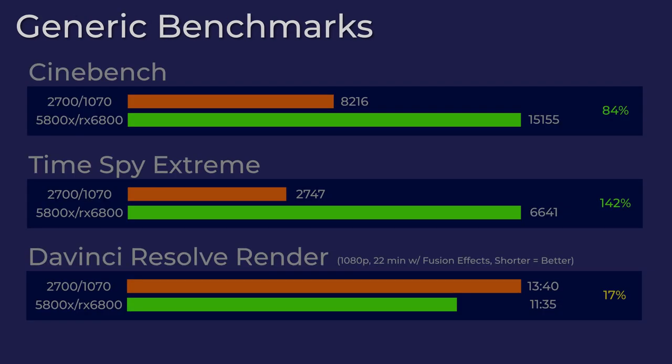So looking at some generic non-gaming benchmarks, Cinebench was just under twice as fast, so an 84% performance improvement. TimeSpy Extreme was almost 2.5 times as fast with a 142% improvement. For the DaVinci Resolve render, I took a 22-minute video, it's actually a previous video from this channel, and rendered it again on both systems. From the same storage device, using the same output profiles, everything was identical except for one was in the old system, one was in the new. And I only saw a 17% improvement.